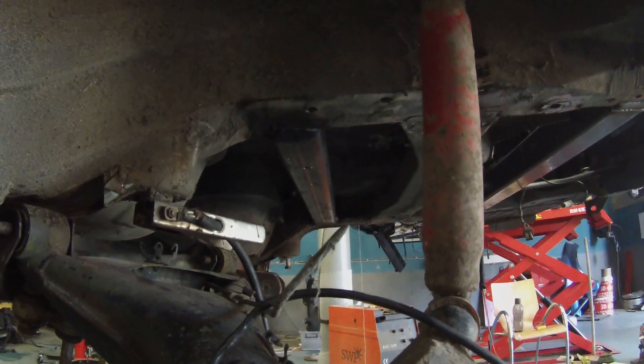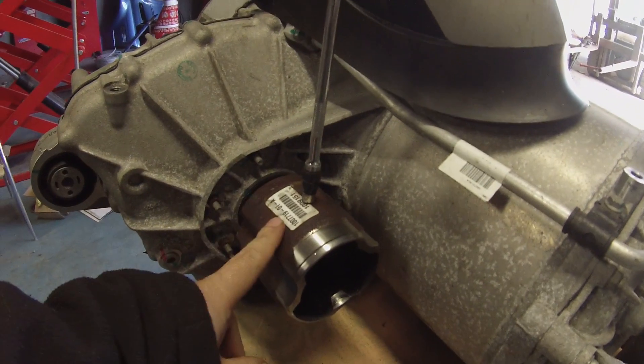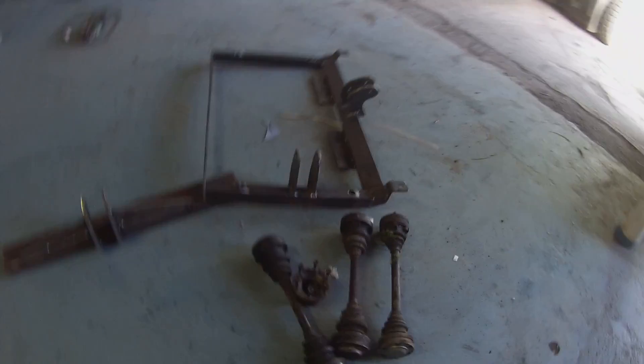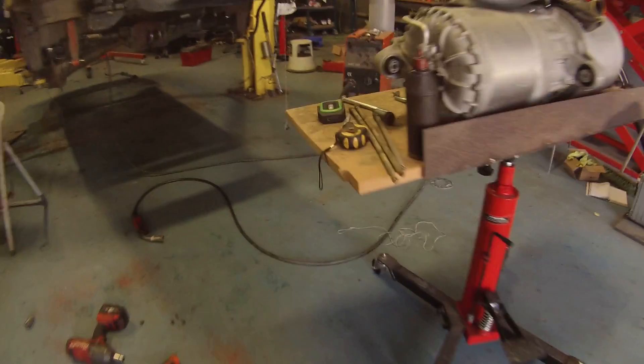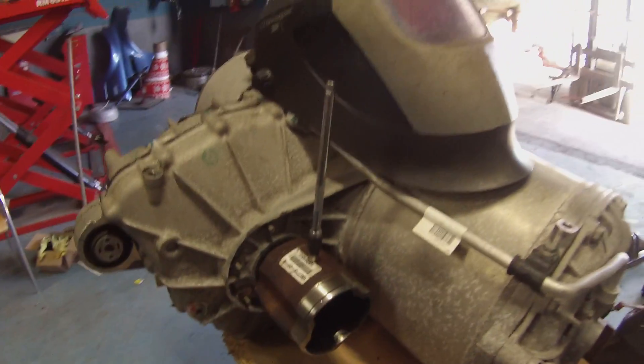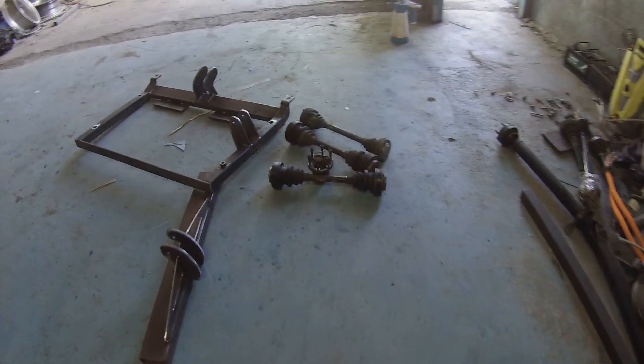We'll be taking the two drive shaft cups out of the motor and leaving those drive shaft cups on our 540 drive shafts over to our engineering guy, who will give us the ability to bolt up these flanges onto a matching flange on our Tesla drive unit. That will be the drive shafts done and will enable us to use stock 540 drive shafts in this vehicle.